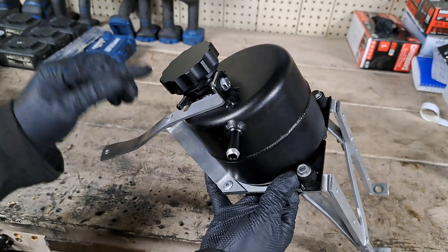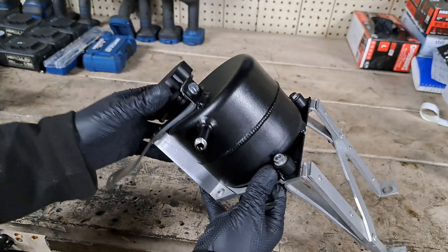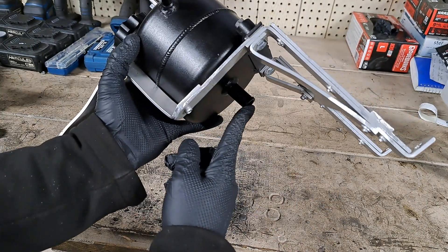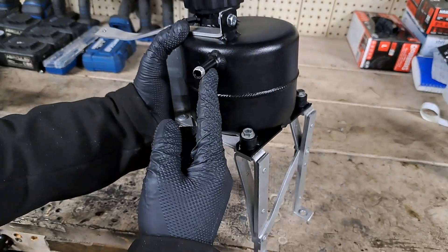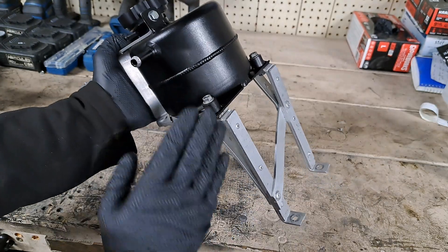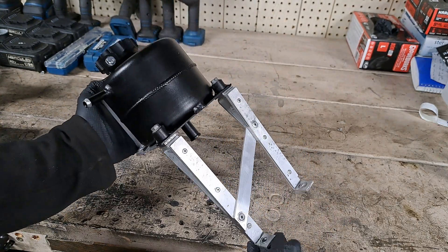The traditional style cap flange allows me to try different rated pressures, and I really enjoy the overflow because the M3 and M5 have an overflow style cooling system — I like that idea versus a totally sealed system. The capacity of this tank is roughly one and a half liters, which is similar to both the M5 and M3 expansion tanks. The bottom port is used for expansion and the feed to the water pump, while this other port is used as a return — like the E46 M3 — derived from the upper radiator hose. I mounted it to the car with a bracket I made out of aluminum.